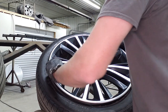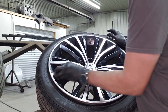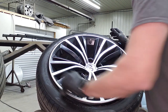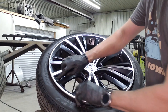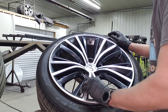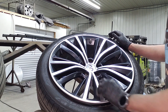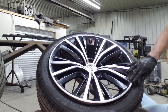For our paint area, we're not doing a full clear coat on the wheel. If you were doing a 100% restoration and they were paying for that, you definitely would want to do that and you would scuff the entire wheel. We are just going to blend and burn the clear in over the body lines where we have these sharp lines. We like to go past the damage a little bit at the sides of the spoke so that the paint wraps around. Then we're going to use a burner to burn the clear in, which kind of takes care of that overspray and hard edge.